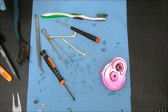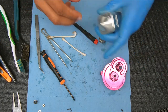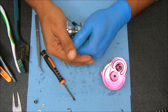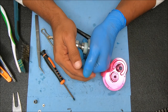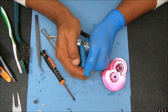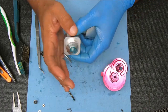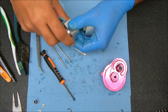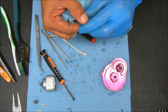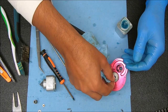Let's go ahead and get the new pinion bearing stuck in there. Like I said, I was going to grease it, so let's go ahead and do that first. You can see it's mixing with the other grease that's in there, but that wasn't enough grease to begin with. Clean that stuff off — we're just going to drop it in, kind of like that.